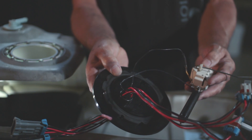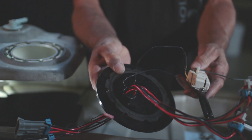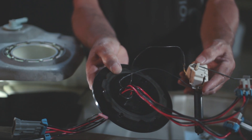When you remove the factory module, I want you to recover two items. Number one is this gasket — it has to be reused for this flange. Number two is the level sending unit. Disconnect it and then reconnect it to this rod in this manner.